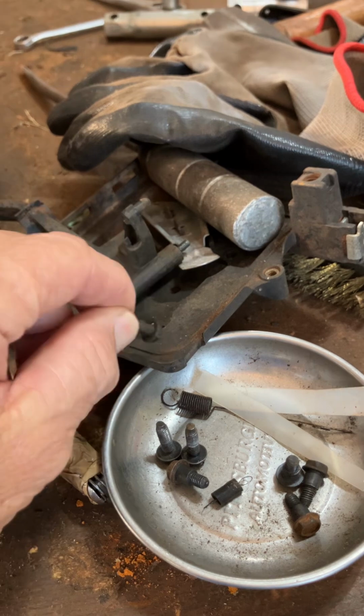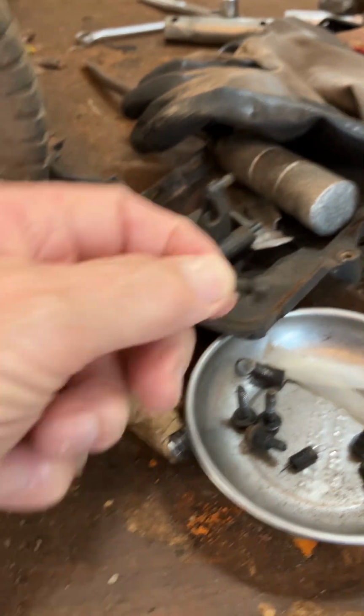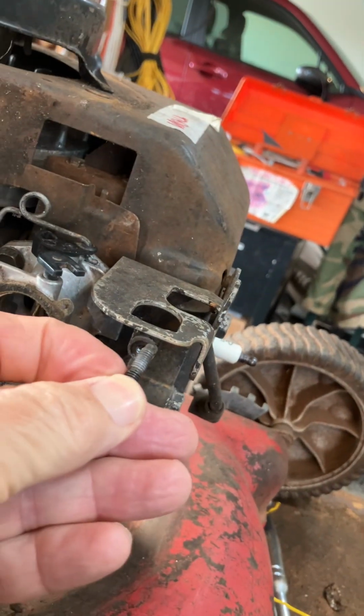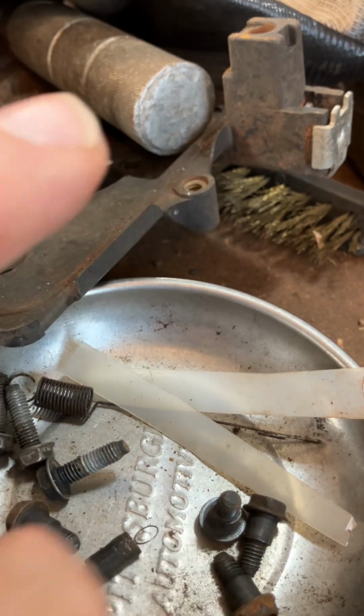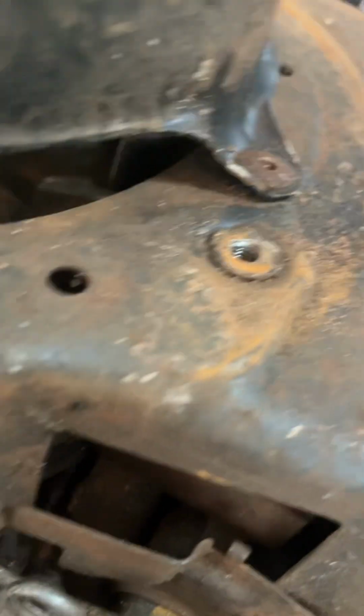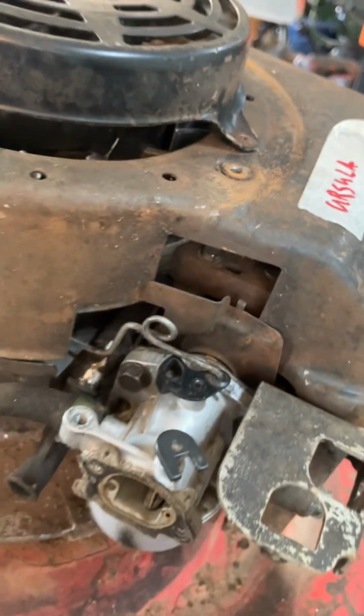I've had to find some parts that weren't included with this mower or had wrong parts. So I've got the three screws that hold this plate on, and they're 5/16, and they screw into the carb, and then one I call the hanger screws in there, so that just hangs that unit on there. I've got three or four of the little shoulder screws, 5/16 head, that screw through the tank and into the threaded parts of the rewinder. So the rewinder goes on, then the fuel tank.